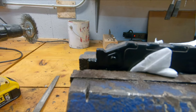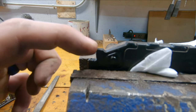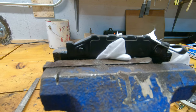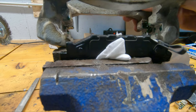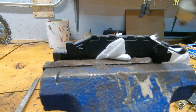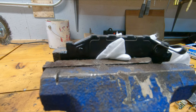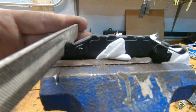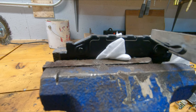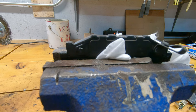The problem is these two faces on the ears that press against the outside of the bracket — the pad is essentially just too wide. Same fix as before: take your hand file — you could use an angle grinder but that risks removing too much material — just a few swipes down each side to clearance a little bit of material so that the pad has more free movement in the bracket and won't get stuck like the set we just pulled off.